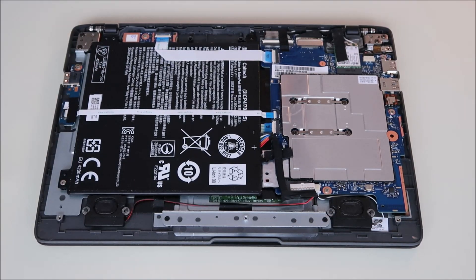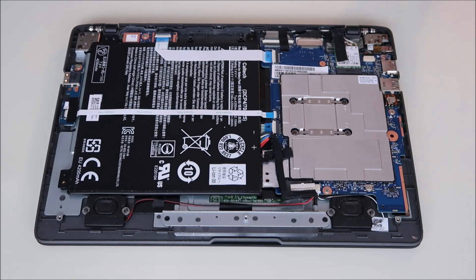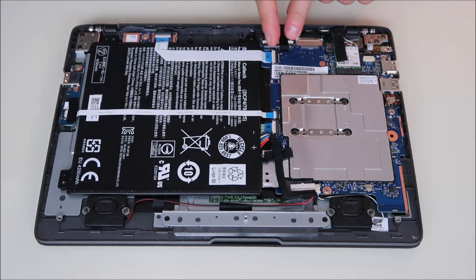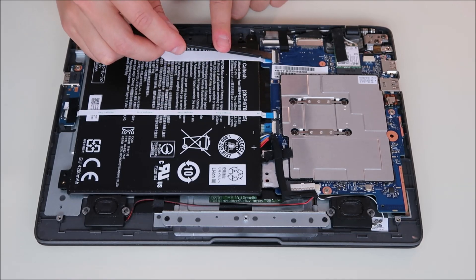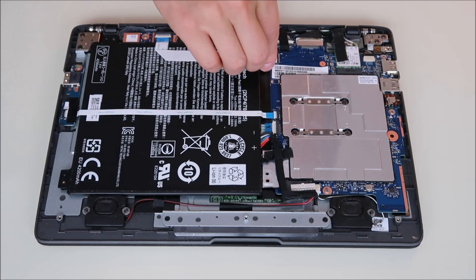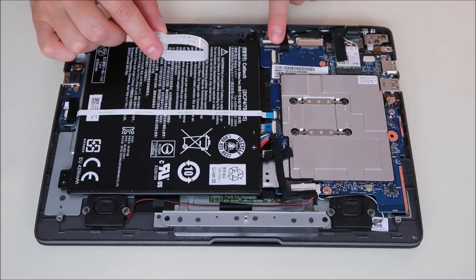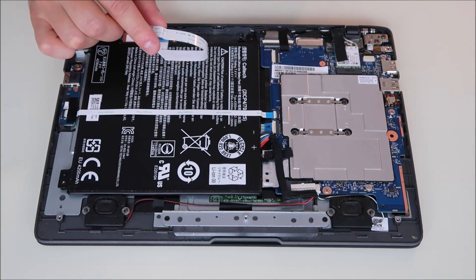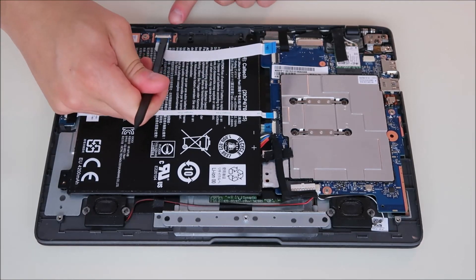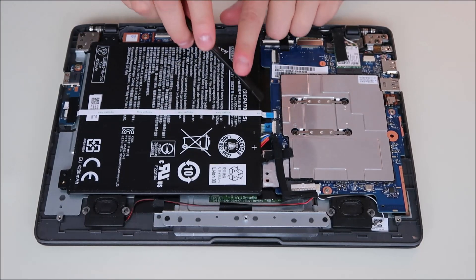Now there's a screw here for the battery — we're going to unscrew that. There are two ribbon cables running on top of the battery and these are held in a very typical way. There's a plastic clip that comes up. You're going to take your flat pry tool, put it under that clip, and gently pop it up. Then you can slide your ribbon cable right out. I'm going to pop that back down for safety. Those parts are extremely breakable, and if you break or lose it — even if it falls off — sometimes they're very hard to get back on and you can break them. So be careful. I'm going to do the same thing on both ends of the ribbon cable: pop it up, slide the cable out, pop it back down.